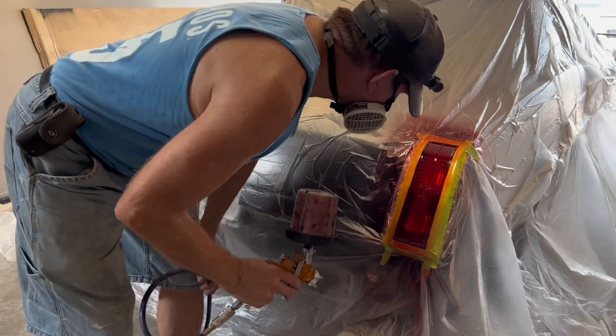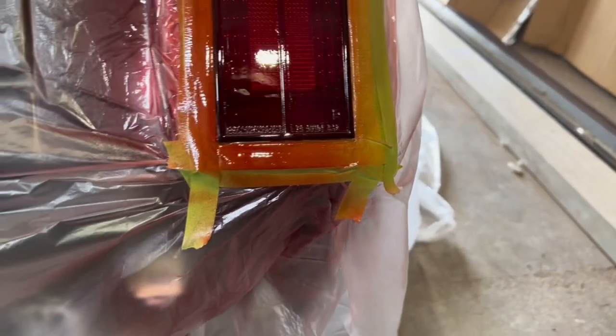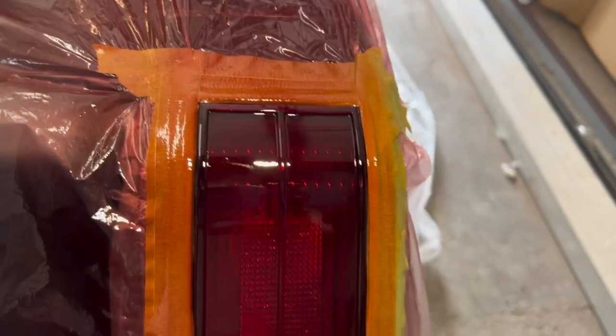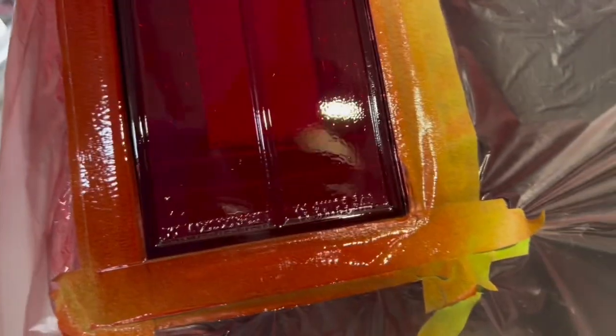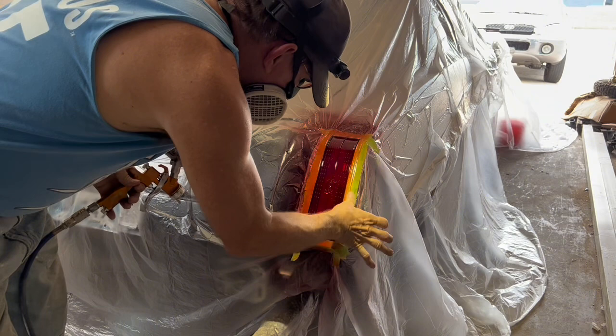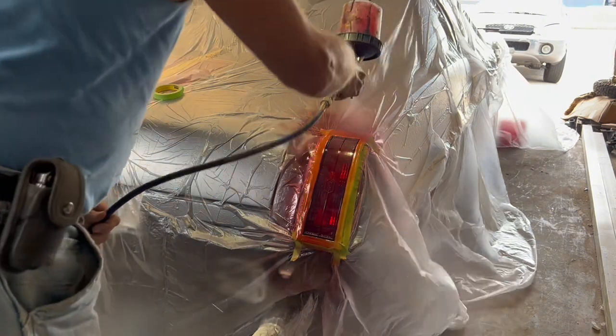I'm giving it the Bondo Billy examination — playing blind man's bluff — but it's getting pretty shiny, looks pretty good, so the next coat will be even wetter. I wait for that coat to be not sticky before spraying the next one. A good estimation of flash time is to put your finger on the clear that's on the tape — if it's a little tacky you can spray, but if it moves like it's still almost liquid, it's not ready. I'm checking it and it's not tacky much at all, so I'm going to put a good wet coat on it.